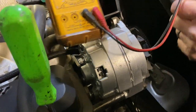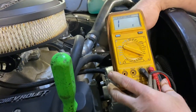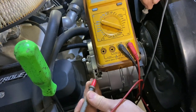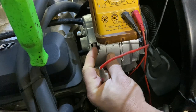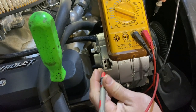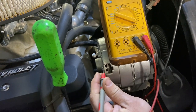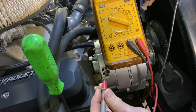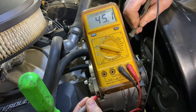I have a multimeter here. I'm on the ohm scale, in the 200 ohm range. This plug right here is a wire that senses from this strap — a lot of the wires went to kind of the end of the line under the dash. But these new harnesses have it where the wire just senses off this lug, which I'm not sure I agree with. This wire on the plug is the exciting wire, and this is the charge lug. If I test from that to ground, I actually have continuity to ground.